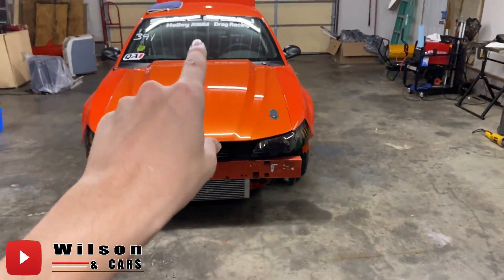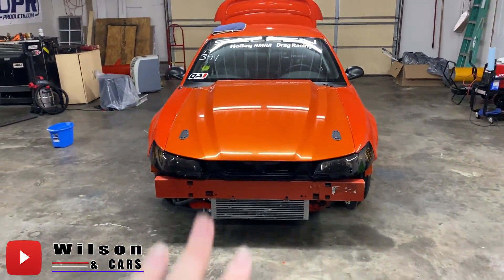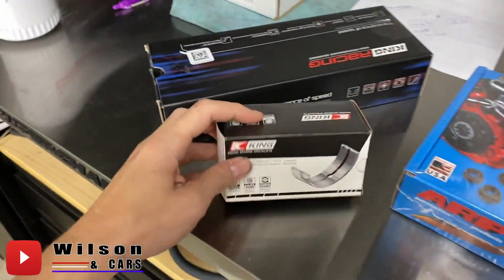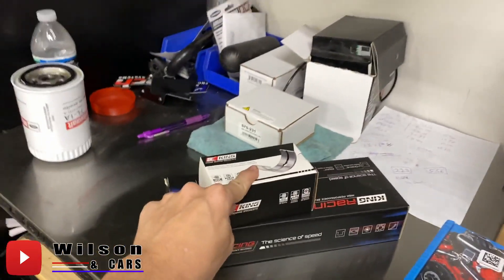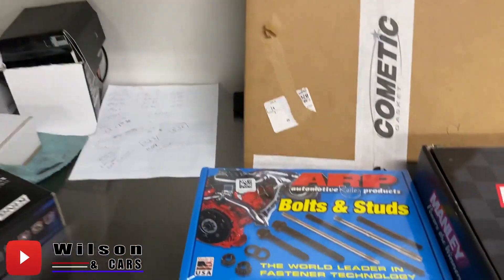In this car we have Clevite — I think that's how you say it — on the rods, and then we have the Speed Pro type bearings, which is what John Lahovic uses over at AkiFab. Those are the same two combinations he uses and that's what we've got in that engine. Over here I also have the King's rod bearings, which are just factory replacement DSIs. We're probably not going to use those — I'm likely going to go back to the Clevite, I think they're like 1440HN or something like that.